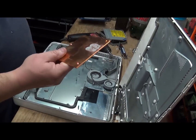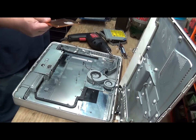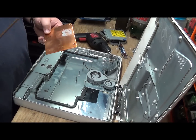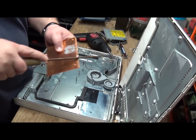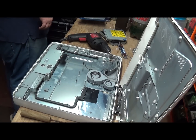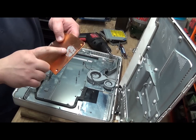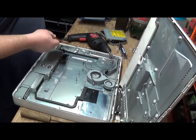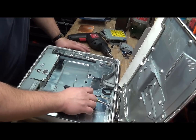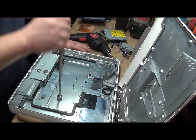There's this beautiful thing in there — that's part of the heatsink. If you take a file to it — because computers can often have aluminum and copper, or aluminum that's copper colored — I can tell right away by the weight that it's going to be solid copper. Take a file to it, and yep, that is a nice chunk of copper. This here is half a pound of copper — I just weighed it. There's a little silver paste on there; you want to scrape that off with a razor. Now this plate — that's steel. A lot of times in these Apples you'll find a lot of aluminum, but this one is magnetic, so that one is steel.